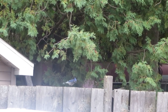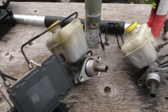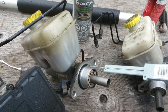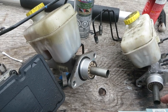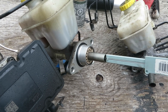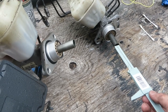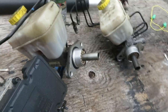We've got the brake booster into the Jeep now. Looking at the master cylinders to put them back in, I took some measurements to determine if I need to adjust the new master cylinder. I verified the length from end to end - it's the same on both. The other part to measure is the depth of the bore where the rod pushes in from the booster, and I found they're identical as well. So I'm going to use the original master cylinder.